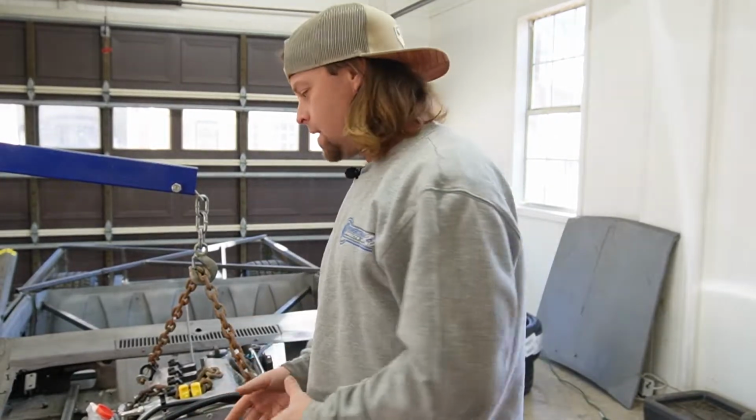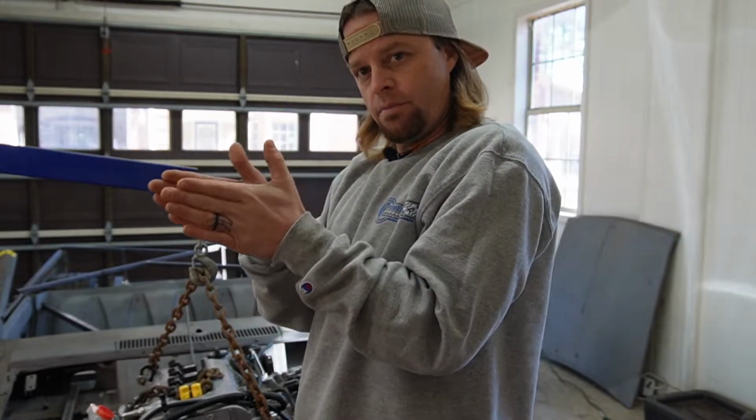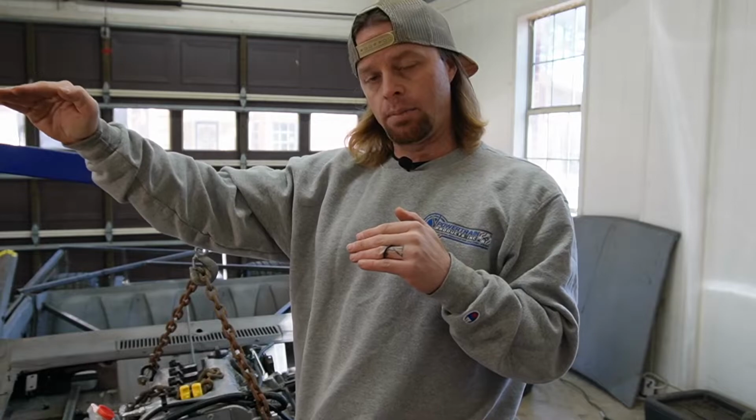Now we have a couple options, the dry sump like we were talking about, but I did forget about something that I mentioned the last time we worked on the Datsun. These Ecotecs are huge in Miata swaps. And I had found a company out there that was building an oil pan that basically moves the tank of the pan toward the front of the engine. It actually overhangs the engine by a lot, and roughly 3/4 of the back of the engine is just a flat pan.